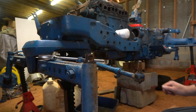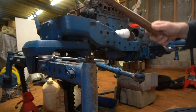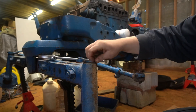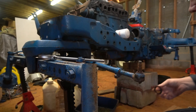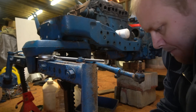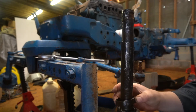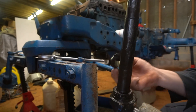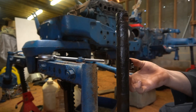Now the spindle — they usually fall out but I think this seal that's hard as crap was holding me up. These are remade so they'll be replaced. And there's our spindle, and oh boy, that bearing's toast. This is not supposed to be a multi-piece bearing — this is actually a single piece but it decided to come apart. That should not happen. These bearings are available.